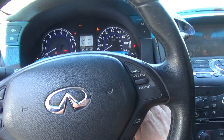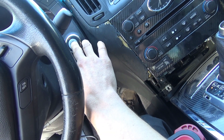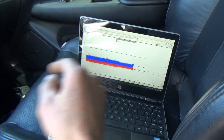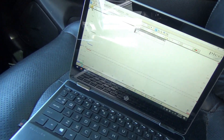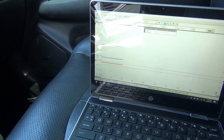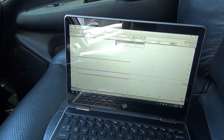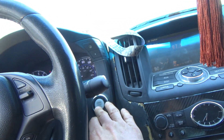So let's go back here. Right there — I shouldn't be able to start the car. We're hung up on 3.4 and 1.3 volts. If I unplug this middle connector, let's see what happens — restore communication, car starts right up. So that's definitive proof that this airbag module is dead in the water.